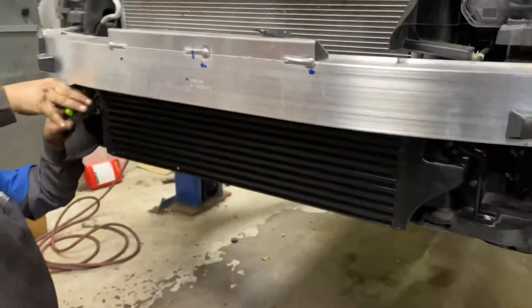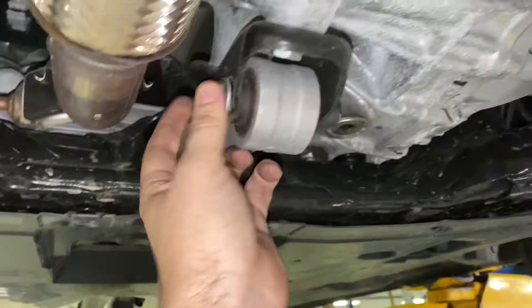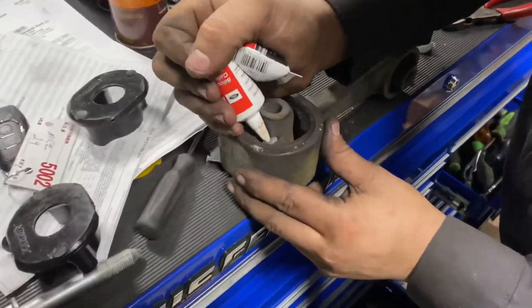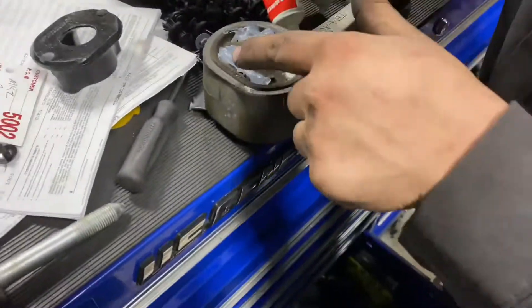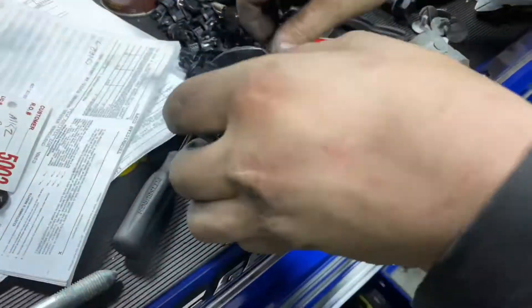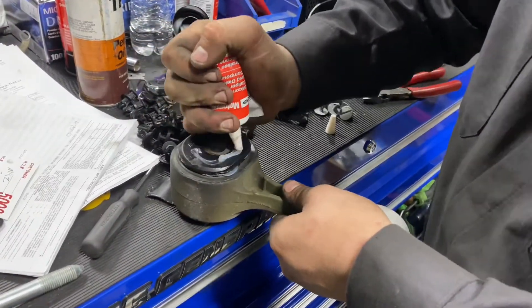Use a 17mm to take this mount off. We'll put some nice lube in the grooves, and you can see the grooves align right there — it's not that hard. Make sure you put some lube on the outside so it slides in there nice. They are somewhat stiff to get in because they kind of hit each other, so lube on the outside helps.